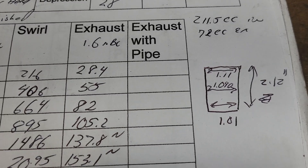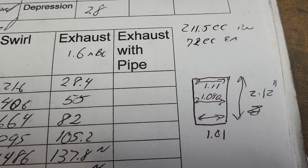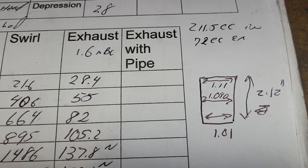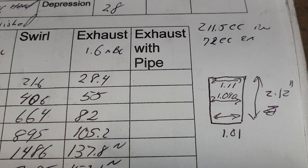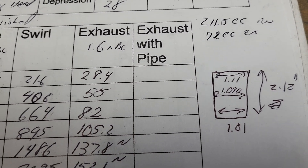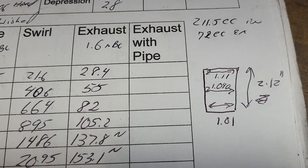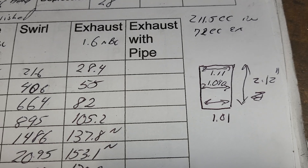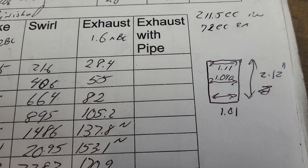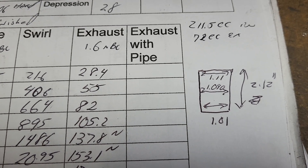Okay, that's what our pinch looks like. It's almost exactly an inch on the floor and gets a little wider as it goes up — over 100 thousandths wider on top. Now, it's like that from the factory; I did not change it, which makes it unbearably thin at the top. FYI, pay attention to that. That's definitely a little DV influence — he likes it bigger at the top and smaller at the bottom. Sometimes I do it that way depending upon the air speeds.